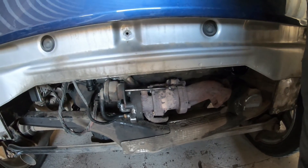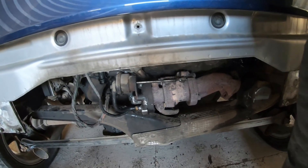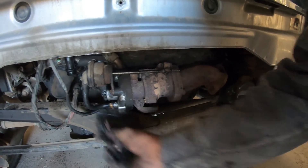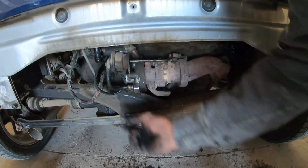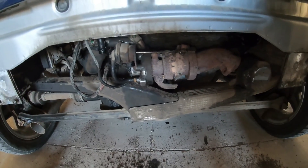This hose is leaking, so the turbo is on all the time, but it also means that I'm losing boost. So I'm going to put a good hose clamp on there so that thing's not going to blow off. I might give it a little snip too just so it's a little bit farther down. So there's one item to fix right there — the wastegate actuator hose.